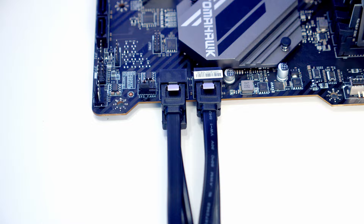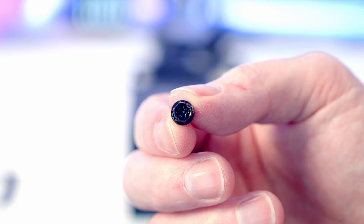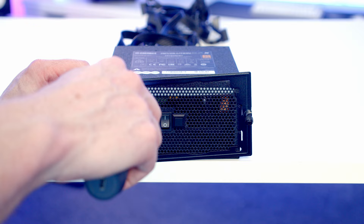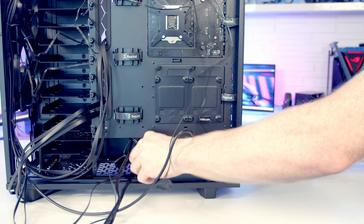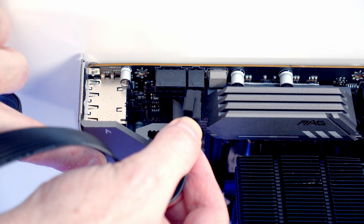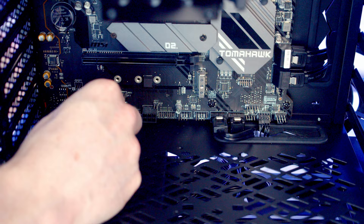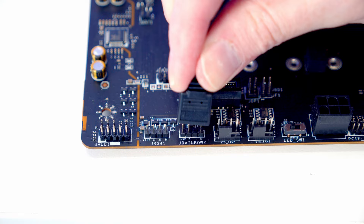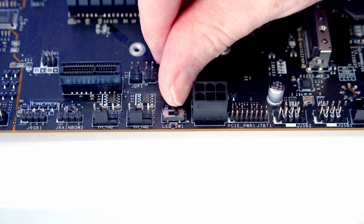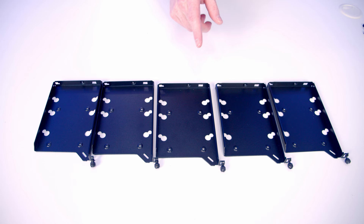Plug the case fans into the fan hub at the top of the case. The power supply bracket at the back is held on with two thumbscrews; secure the bracket to the PSU using the four power supply screws. Pass all cables through to the case, slide the PSU in with the fan facing down, and tighten the two thumbscrews. Plug in the 8+4 pin EPS cable at the top left of the motherboard and the 24-pin cable. The PSU has ARGB effects — I'll plug in the ARGB cable but use the LED button to turn the lighting off. Connect the SATA cable from the fan hub to the SATA cable from the power supply.